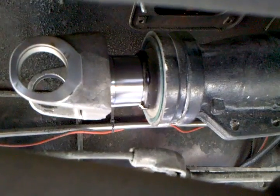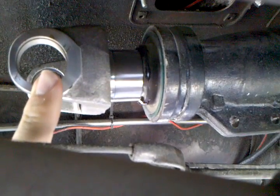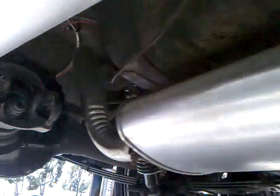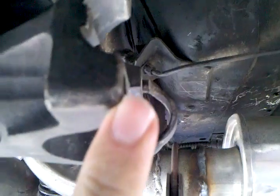Line it up with your pinion yoke if you can. Then you're going to go centerline of this U-joint with your tape measure to the centerline of your pinion yoke here. This one takes U-bolts — as you can see, it does bolt on the back there.